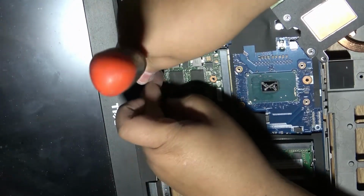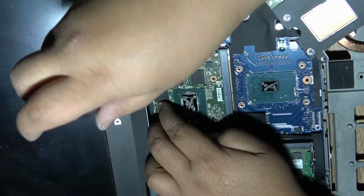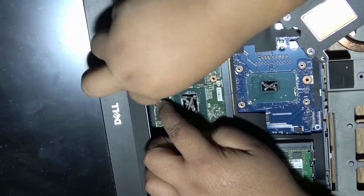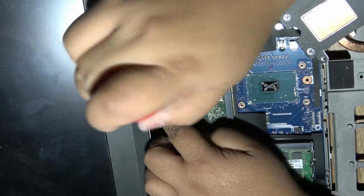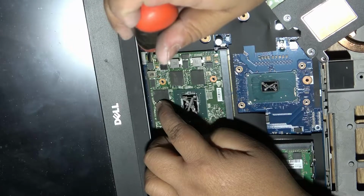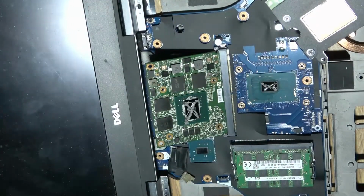The other thing people will argue about is how much heatsink compound to put on there. Well, some manufacturers say just put like a pea-sized amount right in the center. Some of them will say to spread it out. Me, I just put an X across it. One little line one way, then perpendicular, another line going the other way. That's how I've done it. That's how Grandpa did it. That's how America does it. And it's great. We can argue about it, but it works.